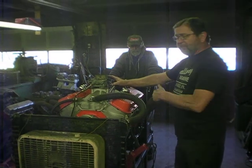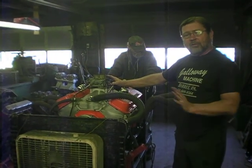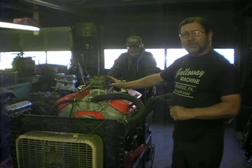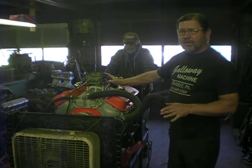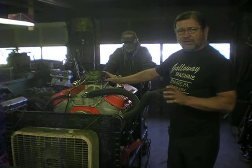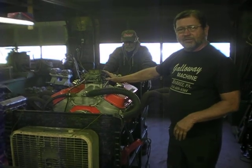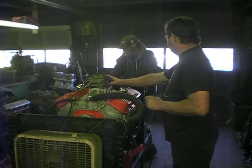And we have mufflers on it. We always do that for the initial break-in so we can hear it. I will let the idle up a little bit just to break things in. Even though it's a hydraulic roller cam, there is no cam break-in, but I still like things to idle up a little bit till we get tuned in, and then we start to idle down. So here we go. Open the door.